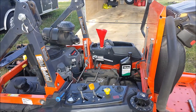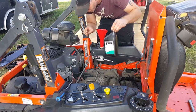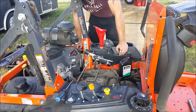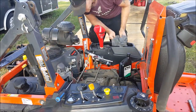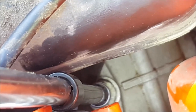Okay, so 2.5 liters, and the transaxle is still not completely full. I've let the expansion tank drain completely. It's hard to see, but you can see the drain hole that drains into the Parker pump. So I'm going to go ahead and add another quarter of this remaining quart. Here, I'll show you what we're looking for in this breather port. Maybe hard to see. So down in there you'll see I have the socket already on it. But not seeing any oil come out of that yet.